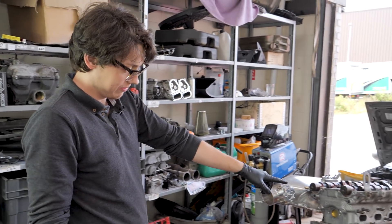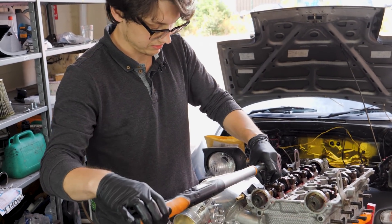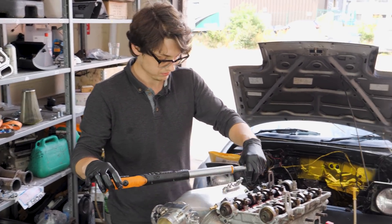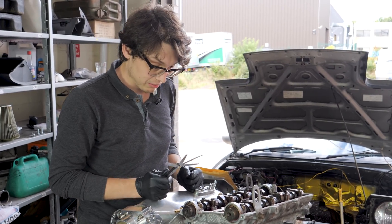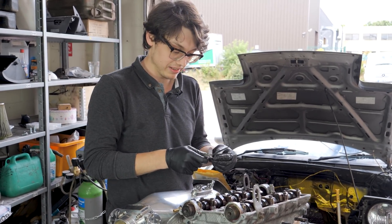That's going to look like we'll probably have to re-drill the cam gear for that. Now that we've torqued the cam shafts down, I had to double-check that everything is correct. It looks like it will be based on the math. So I'm just going to use the feeler gauges to make sure everything looks like it should be working.